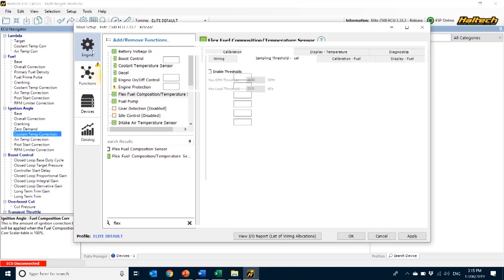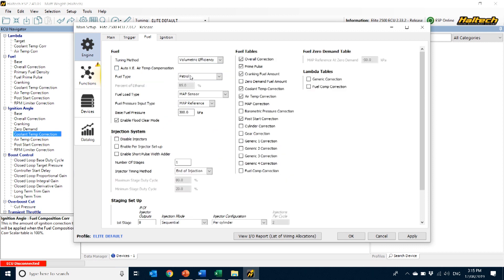Once the sensor's been set up in the main setup page, we're ready to start working on the fuel and ignition calibrations to ensure the ECU delivers the desired amount of fuel for the actual ethanol content. The simplest way of achieving this is to go into the main setup window, click on the fuel tab, and select the fuel type to Flex Fuel. This tells the ECU to look out for a Flex Fuel sensor and automatically calculate the additional amount of fuel required for the engine to meet the target air fuel ratio. Now this is where it gets interesting — we know from the chemistry what the mathematically correct amount of additional fuel is, but in the real world just adding that amount doesn't actually work out. The actual air fuel ratio measured from the lambda sensor in the exhaust tells us it's out by a couple of percent.